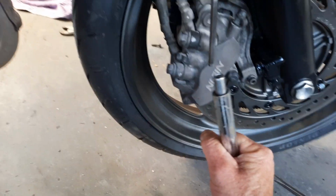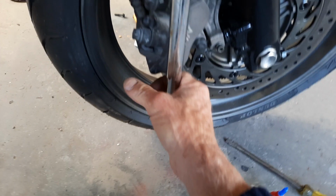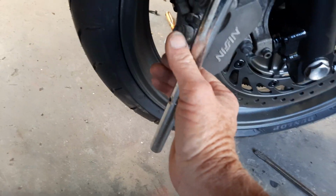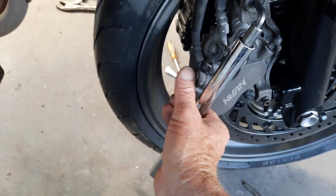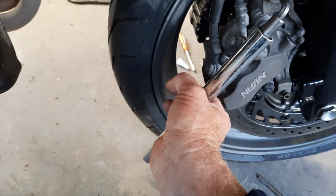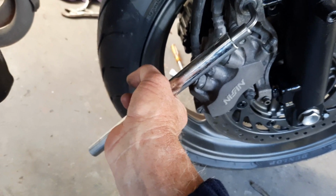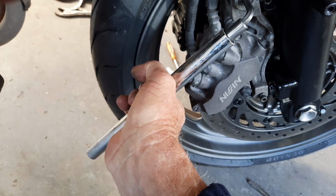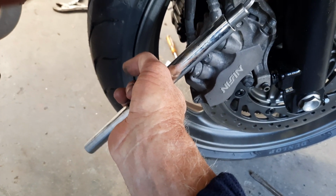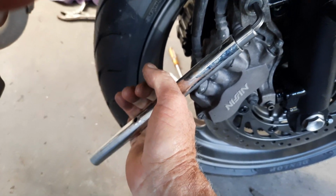But yeah. So when I go to do it up now, hold it at about the same length as what a spanner would be for this size bolt. It'll turn. See, and that's come to a stop now. And now to make it go any further, I have to put more pressure on it. See? So you go just a little bit, right? And that's enough.